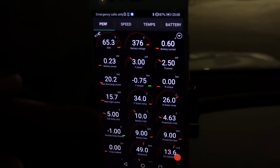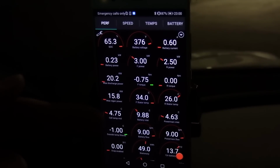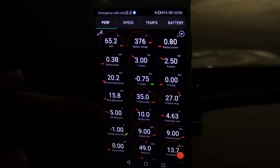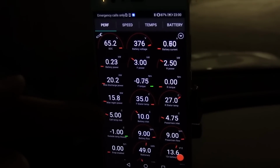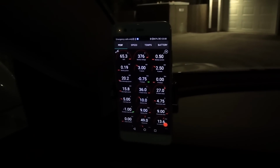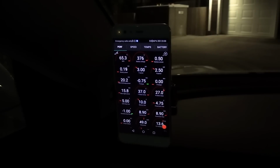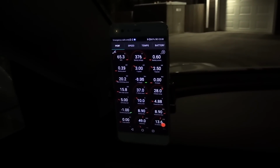So this is a tip: if you plug it in at your cabin and the car has been stationary for a long time, it will try to heat up, but I don't remember how high. I think it was maybe 10 degrees or something before charging can start. And also, if you've been charging on Schuko or something really slow and it's really cold outside, then that is simply not enough charging power to keep the battery heated.